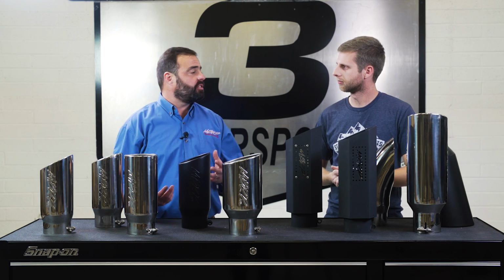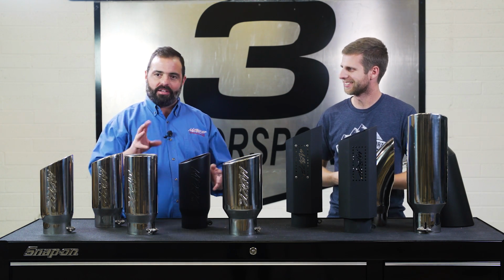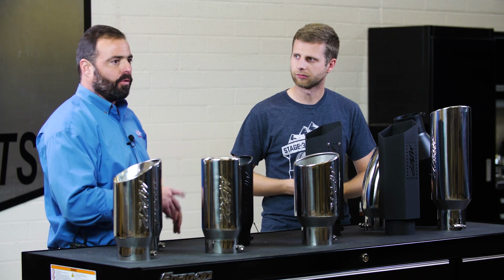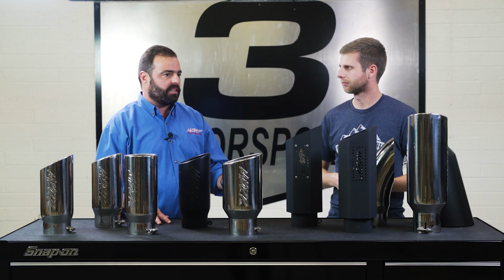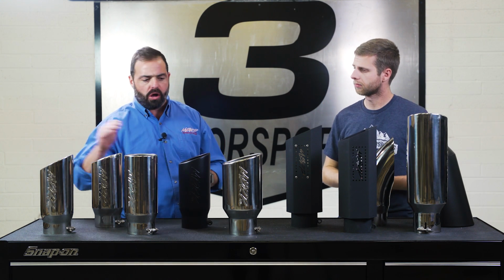All of the resonance tuning, which is what we talk about, and the word of art for affecting sound, comes north of that in the exhaust system with a combination of mufflers and resonators. And a resonator is just a small muffler with an R in front of it. By the time you get back here, it sounds how it sounds. So it's really just about the affectation, the look you're going for, whether or not you worry about bluing for the dual wall and things like that.